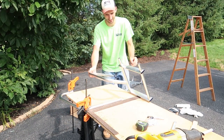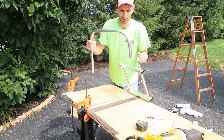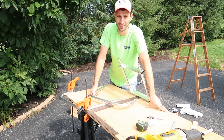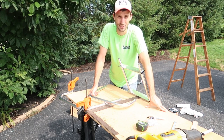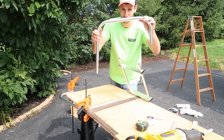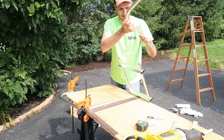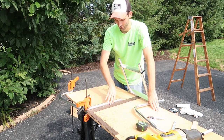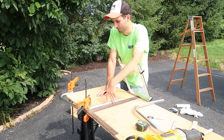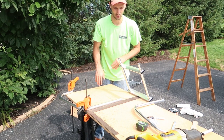Item two on the list is attaching the ladder. The ladder posts are pretty long to start out with, and we don't want them sitting seven inches or so above the roof deck, because we don't want our height to be too big to go under a lot of bridges and overpasses. So I'm going to be trimming these down to make them closer to flush with the top of the roof. I have one clamp at the table here with a square to make sure the long side will be perpendicular with the back of the bus, so if I cut right along this line it should make a nice flush edge.